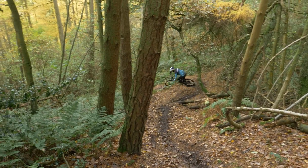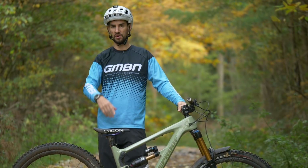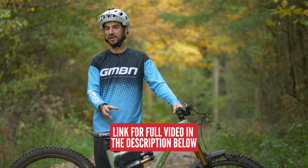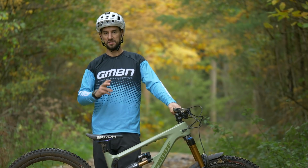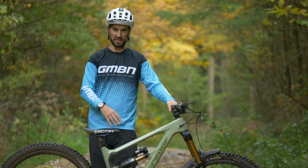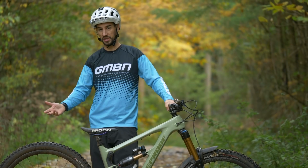It's also a really good idea to make sure your bike is winter ready. So Rich has done a full video on how to winterize your bike. But for me, what I do is I'll make sure the bearings on my suspension linkages are freshly packed with grease. So it's going to keep the worst of the water from the rain, but also from washing the grease out of those bearings. And hopefully your bike will come out the other side of winter in a reasonable condition.